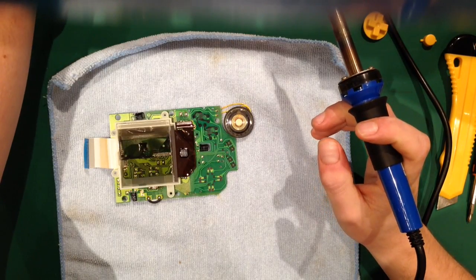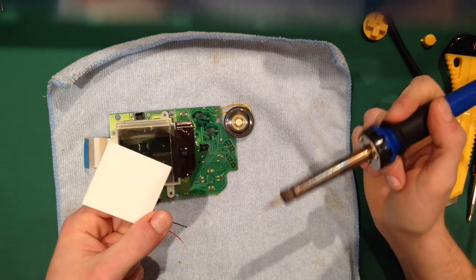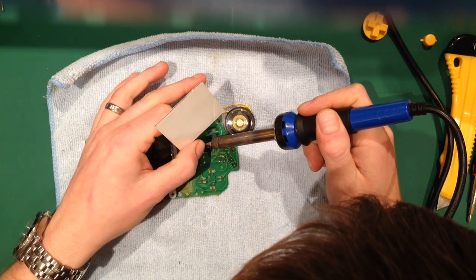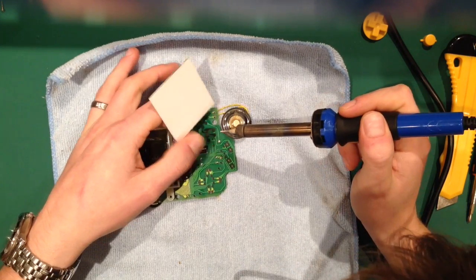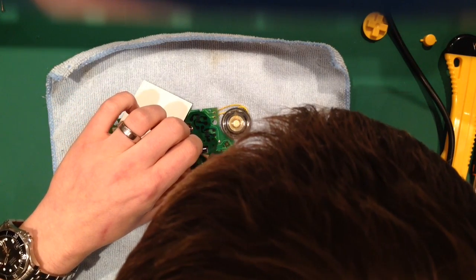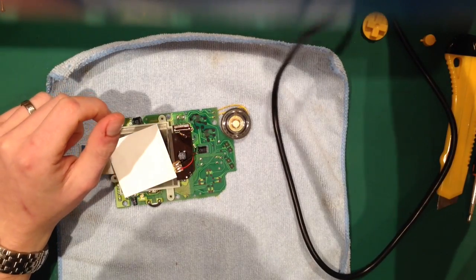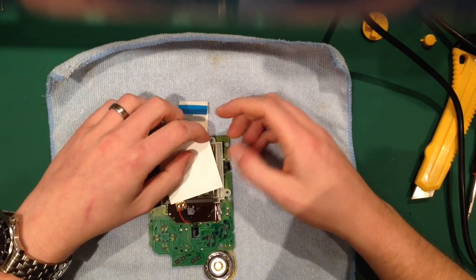Because these are going in what could be really old solder, I'm going to pre-dunk the wires in flux again. So, negative onto this one. Try and fish it through so it goes all the way through the circuit board. If you can't, it's no big deal, but if you can, it just makes the contact so much better. Look, that one's gone right the way through. So anyway, that's that, and that is the hardest bit by far.